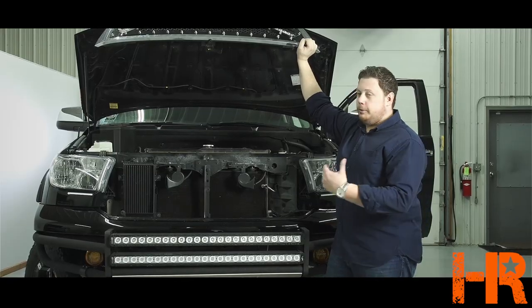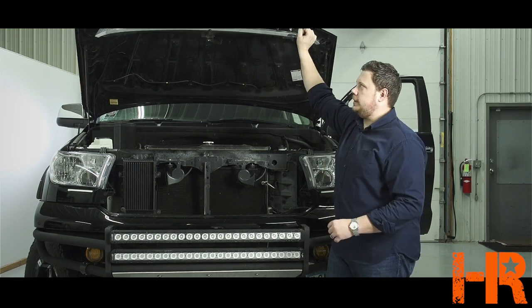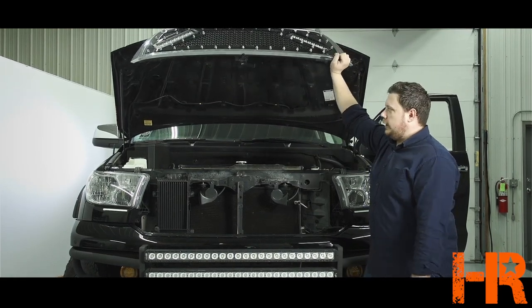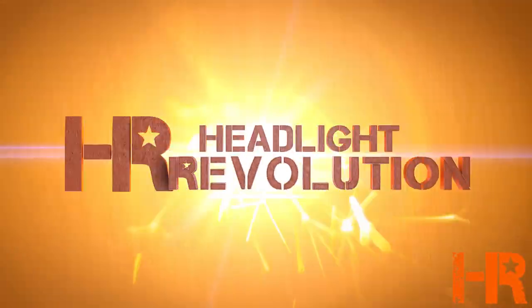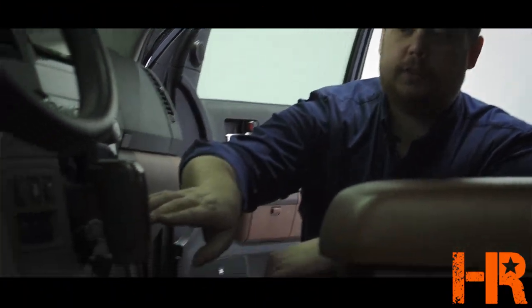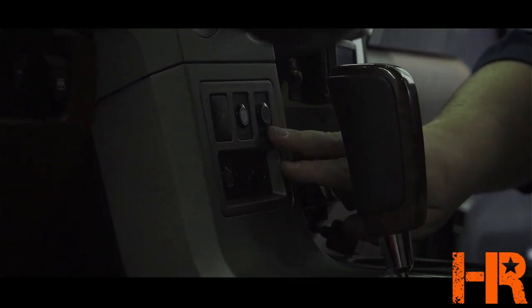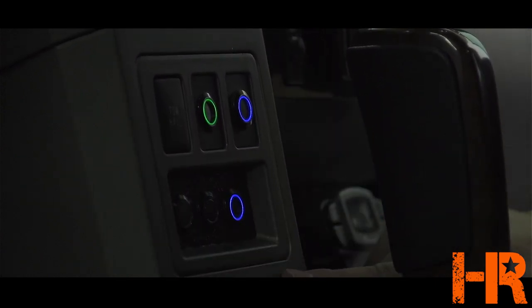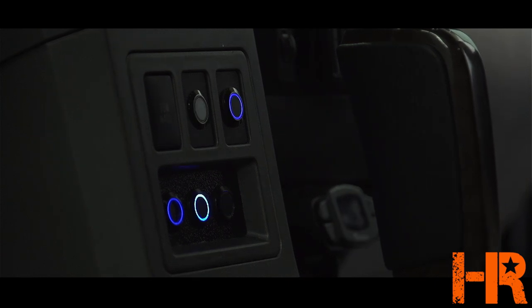The install is all done — we have the grill mounted, the wiring installed. This thing is heavy; I didn't need any help lifting it before, but now the stock struts which were working fine 20 minutes ago no longer hold the hood up. On this 2010 Tundra we actually made a switch panel in the stock location where the auxiliary switches used to be — we used GTR Lighting LED halo switches, mounted five of them, all connected to different auxiliary lighting: the roof light bar, the bumper light bars, the fog lights, the new Royalty Core grill with Vision X lights, and a flasher module to make the whole thing go nuts.